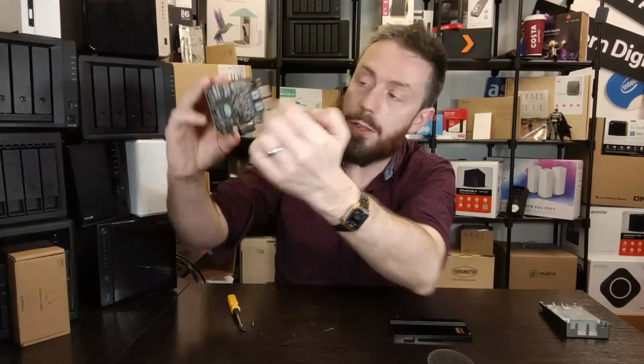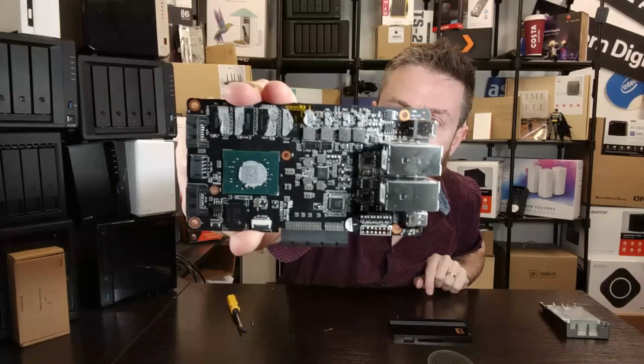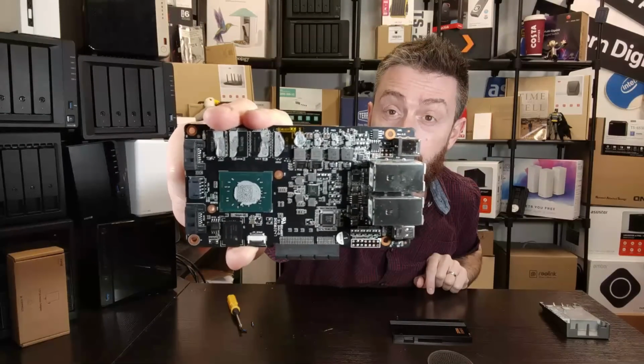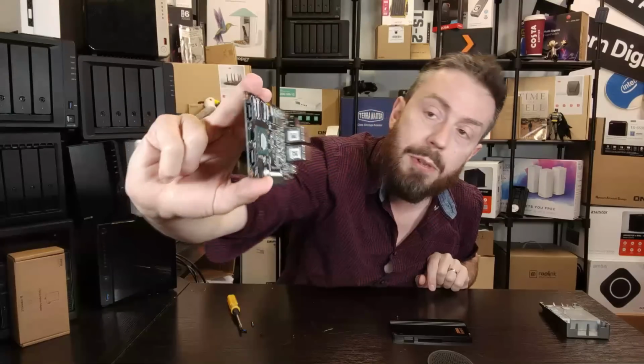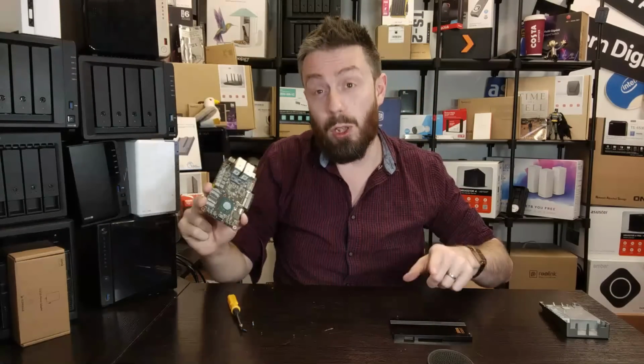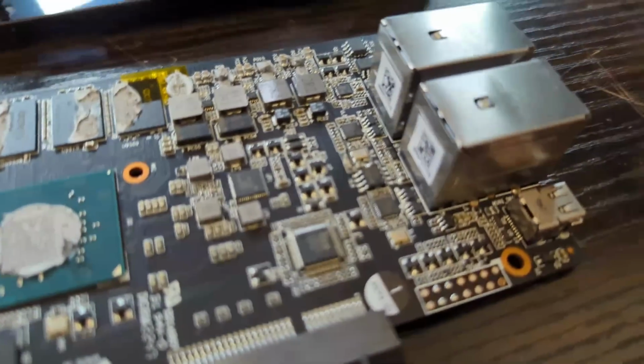Another thing that's worth highlighting is, of course, the memory there at the top. Now, bringing that closer to camera, where my fingers are there are 4 individual low-power DDR4 modules there, LP chips. Now, this is the 8 gig model. The 2 gig model obviously only has the 2 chips, but it's not upgradable or changeable.